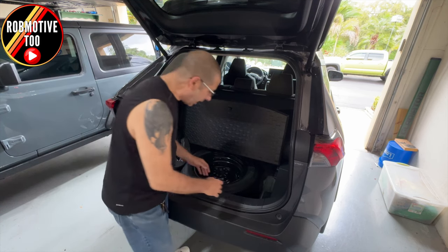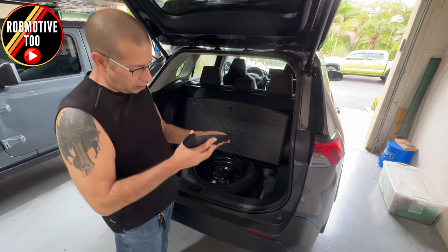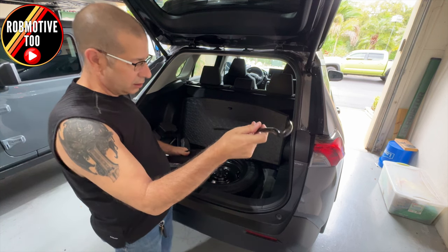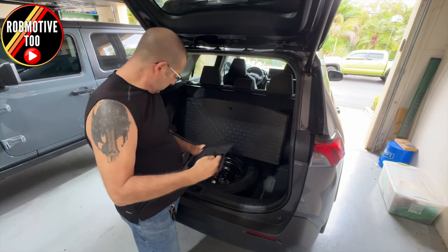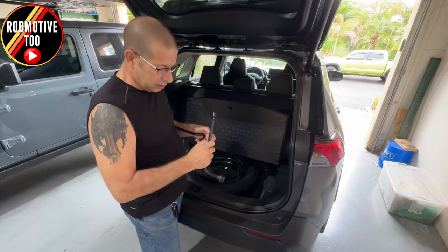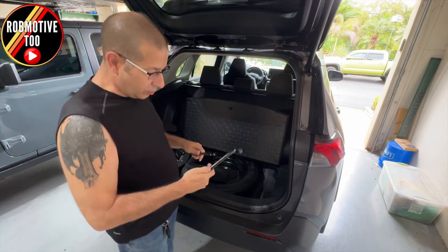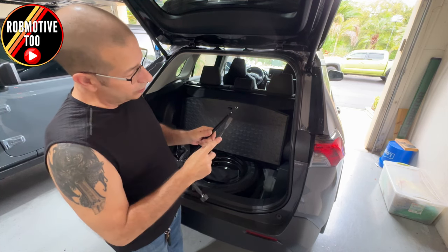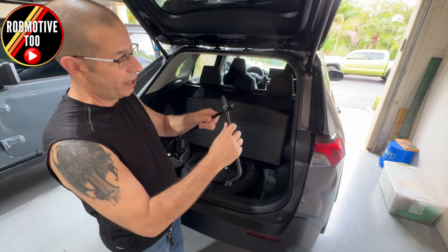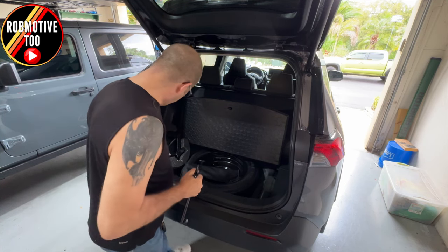Well, how do you operate the jack? Well, right down here, it's kind of sandwiched underneath the spare are the tools, I guess. Not much in here. So let's see what they actually give us. They give us a rod. It's got to be more than that. And then they give us a lug wrench, which obviously you're going to need to get the lug nuts off. The way this thing works, it's not too complicated. They have a little nub on here you're supposed to overcome when you put this thing in, like so it can't pull back out. And then, obviously, you would want to hook the other end around the jack.